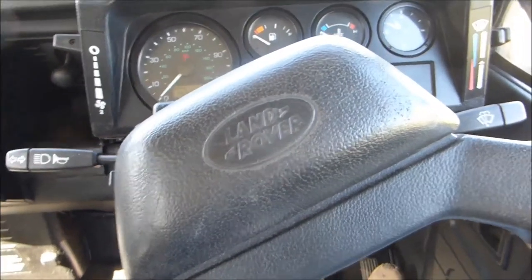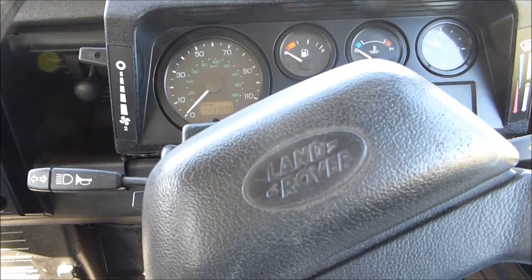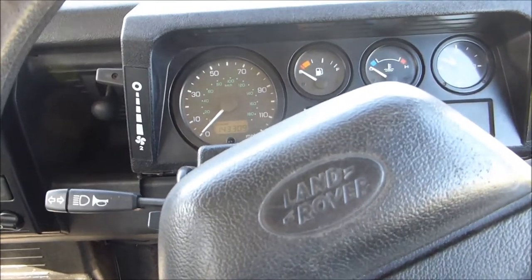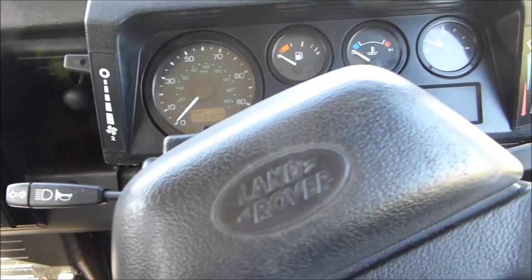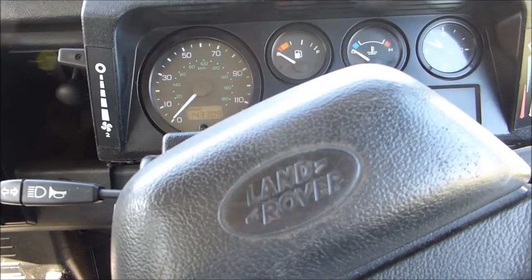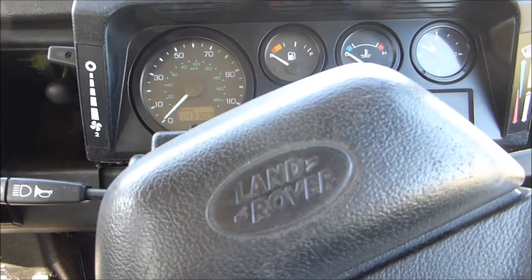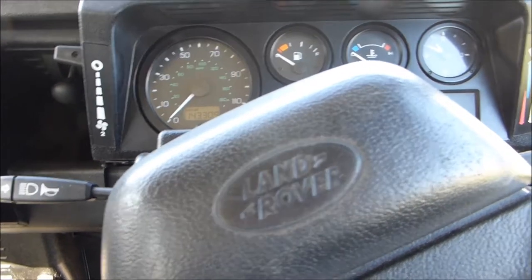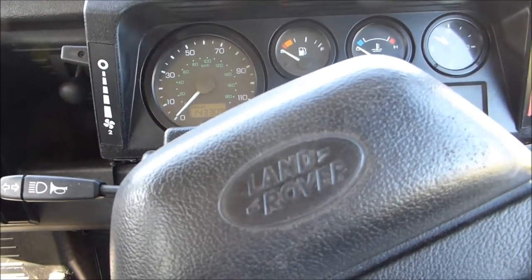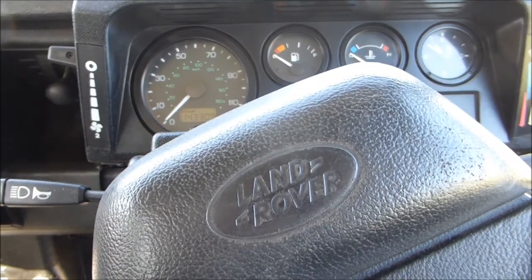As you can see the steering wheel is slightly to the left of centre, which means I've only changed the ball joint on the drag link. That has only got one ball joint — the other end is fixed, as I'll show you in a minute. So I've got to extend it by screwing out the thread, and I'll show you that in just a second. I'll get underneath and name the parts.